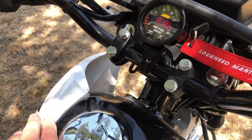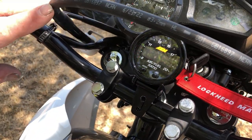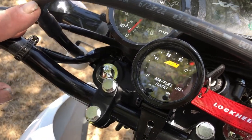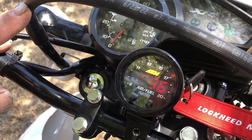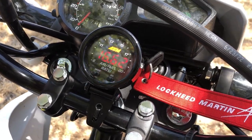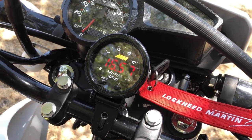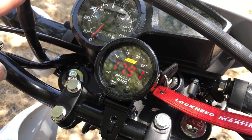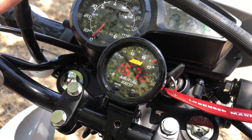Make sure my fuel's on here. Okay, still heating up. Alright, there you go. The gauge is sitting at about 16 and a half. It'll probably go down a little bit when it warms up, but it's most definitely running lean right now. Flip the throttle a little bit — okay yeah, you can see it goes rich enough there, then it comes back a little lean though.